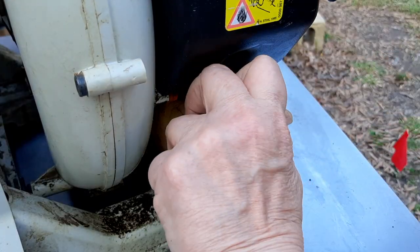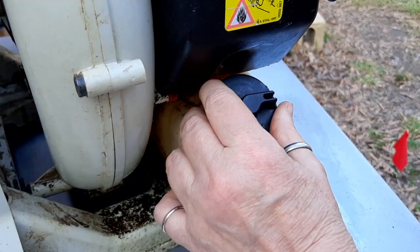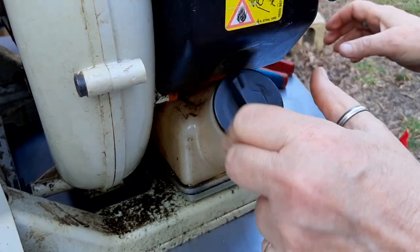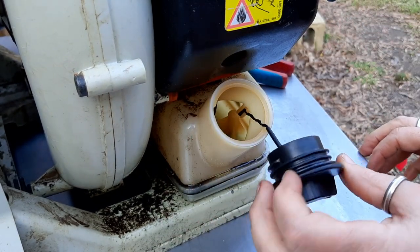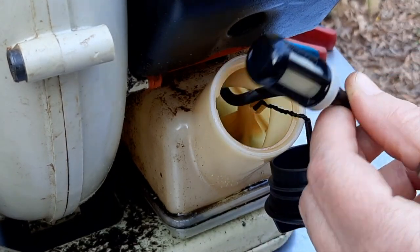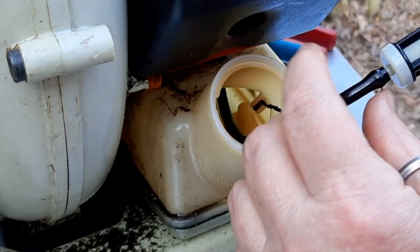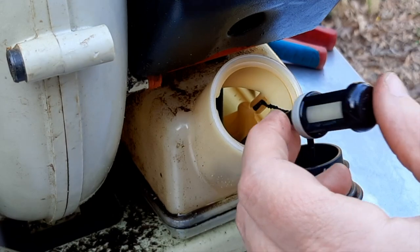Let's check inside the fuel tank. There's a lot of pressure there — maybe it might not be venting well. The fuel filter, I don't know, it doesn't look too bad, but that doesn't necessarily mean anything. We'll check all that.